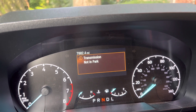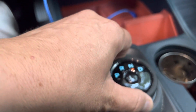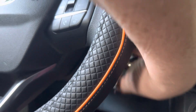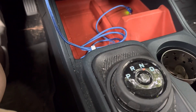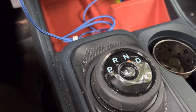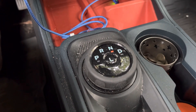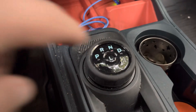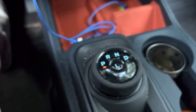How do I put my transmission back in park? Does it still work? No — the transmission doesn't turn at all. Of course, put the car off first. Turn the car back on and I am still in neutral mode. The car isn't physically moving since there's no incline here, but we're supposedly still in neutral. If I push L — nothing. You just have to put it back in park, and then you're out of temporary neutral mode.